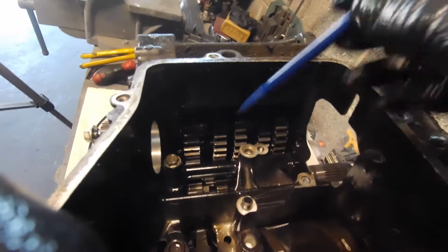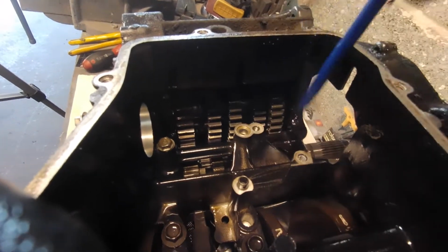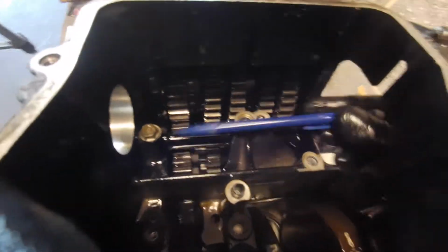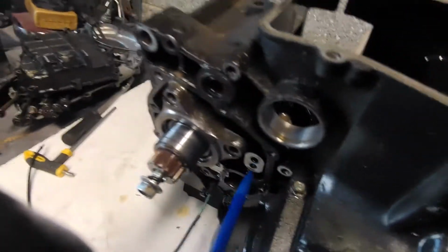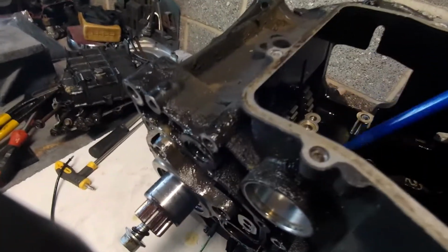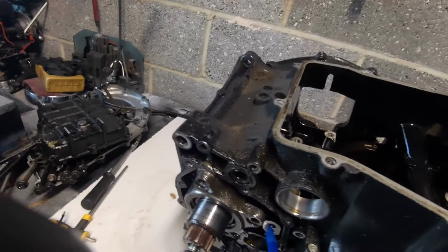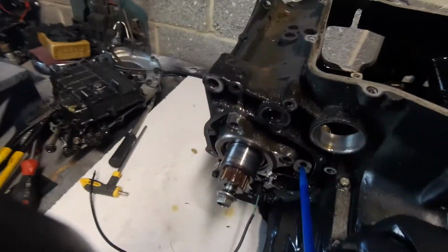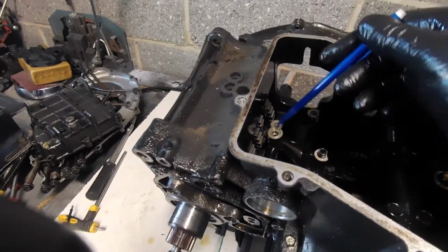That's what I meant to say: out the pump, if you remember, we said there was a separate side that feeds the cams. There it is, out the pump, it sits on there and goes into that little casting here. It's obviously been drilled in the manufacturing process, which is here. That's the feed to some of the, we'll find as we take it to bits a bit further, you'll see there's separate circuits that go to feed the bearings, and obviously that feeds this bearing with the cover on. But yeah, the oil side for the camshaft is fed there, so it really is a bit poor.